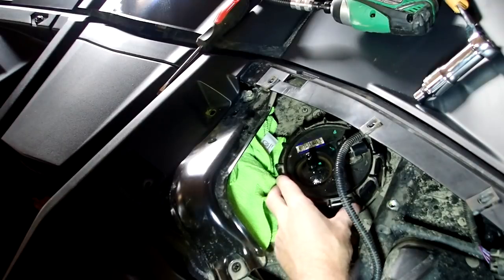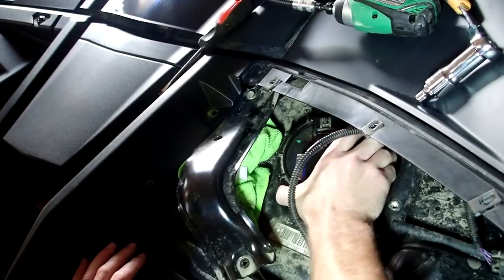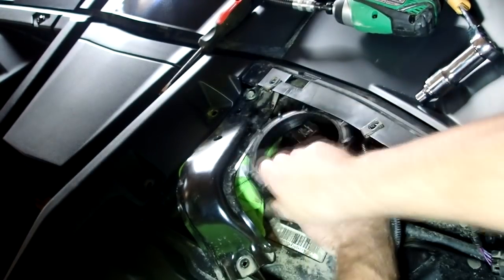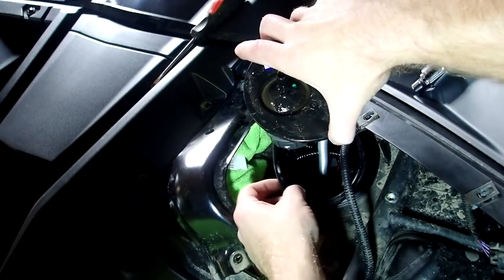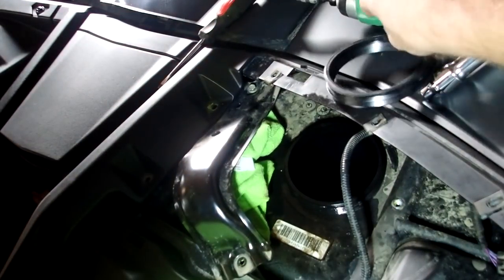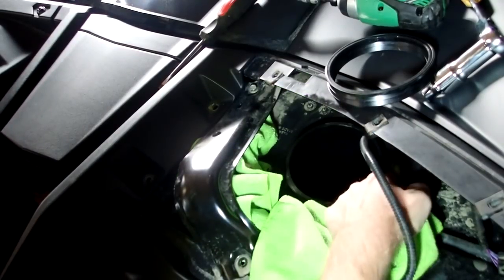The next piece is to remove this fuel pump locking ring. It's spring loaded. Let's see if we can't weasel this out of here without taking this plastic off. You got new seals with the kit, so don't worry about getting those off. Old fuel pump out. Before we get started putting things back in, you want to make sure you wipe up the sealing area around here of any spilled fuel and dirt, at least to the best of your ability.